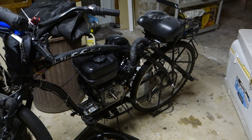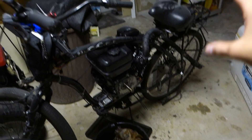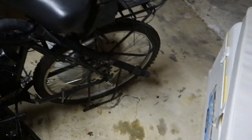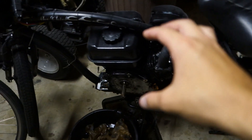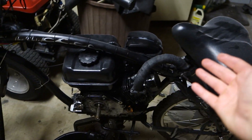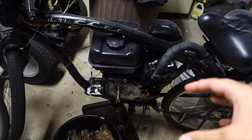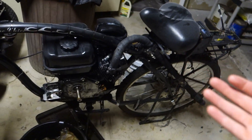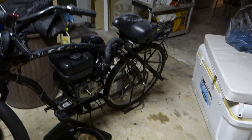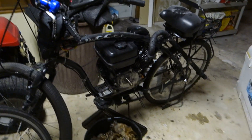And I know there's going to be someone who wants to fight about this — I'm not fighting about it. But this engine on a bicycle is really, really stupid because these axles are smaller than a pencil. Literally, they are so small, they are not made to take the power from this engine, especially with a torque converter on it. So why do you all say build this motor out? I'm not doing that because it's already got way too much power as it is, and you can only use about 10% of the throttle. If I put a 79 on it, I can at least use probably 60% of the power rather than 10. All I have to do is sneak the throttle, and that's how I ride the bike.